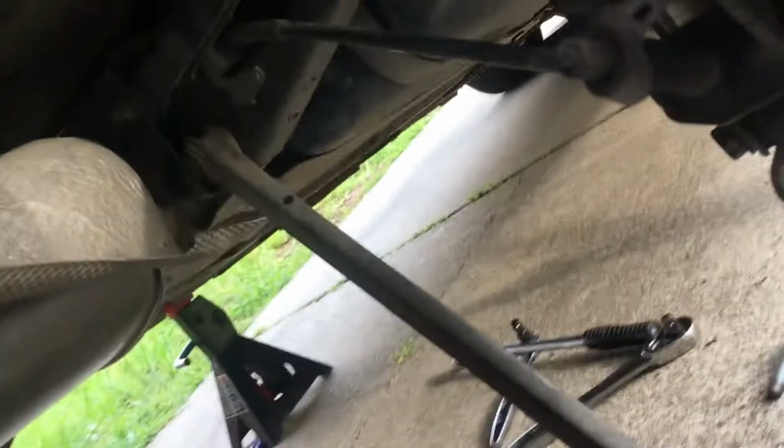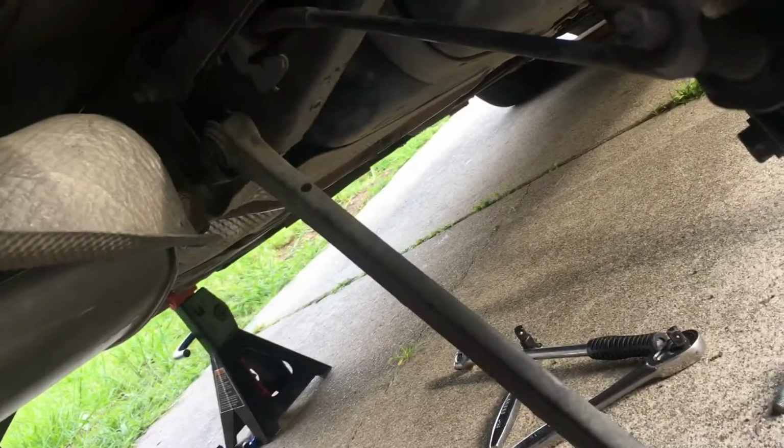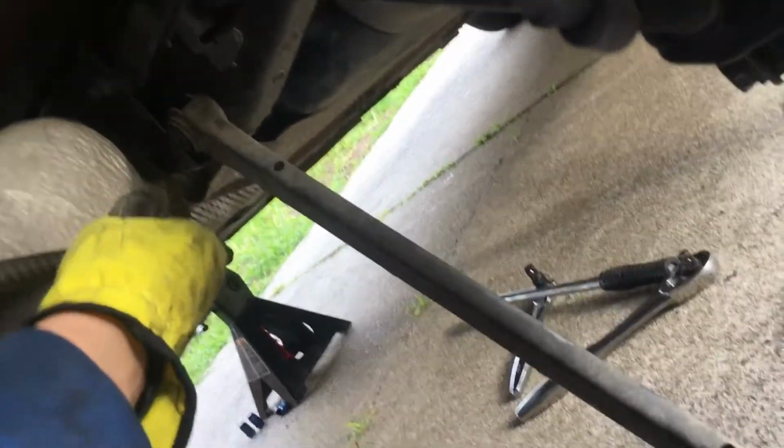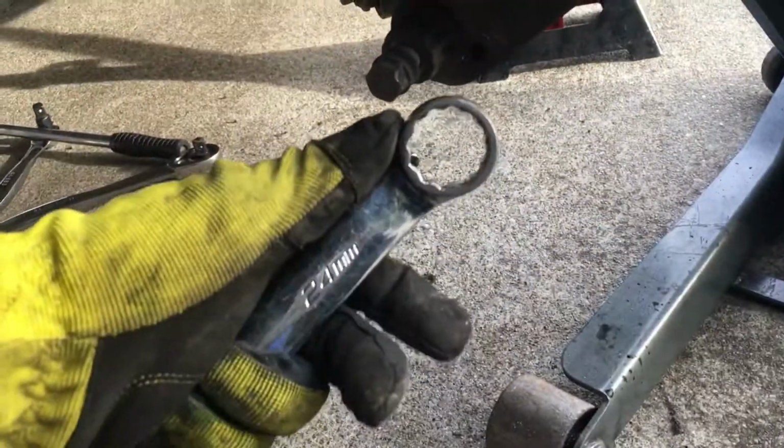towards the gas tank I used an 18mm socket, and then I used an adjustable wrench because I didn't have another 18mm, but I pretty much had this here with 18mm on the other side. I loosened it, and once I had it loosened, I just unscrewed it and torqued it out. This was a 16mm, and this is a 24mm 12 point, so you hold that in place and then you use the 16mm to loosen it.